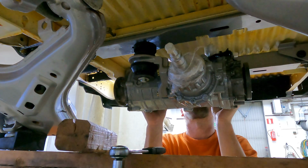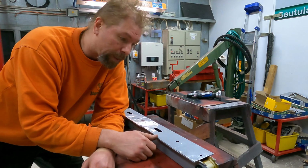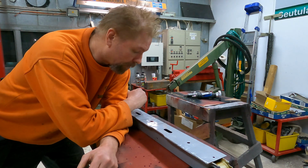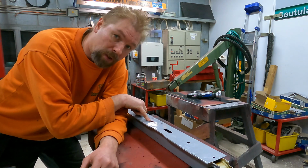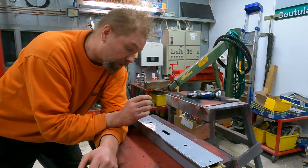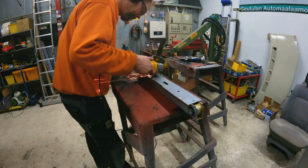I need to find the torque. So I think I could finish this video here with installing the rear differential. As you see, it went to the place already. But I couldn't find the torque specifics for these bolts, and I over-tightened them, or perhaps this nut insert was rusty already. So I listened to several guys, you need to open this just to repair the threads. So I need to do it for the one bolt, and I hope I can install it into the car when I repair it. The other insert's not going off. So I made already very good rust protection for this, and now I need to cut it out.